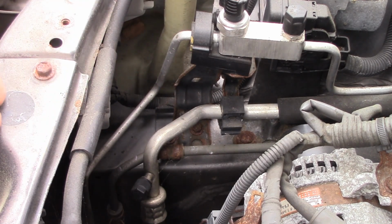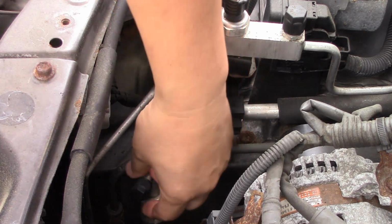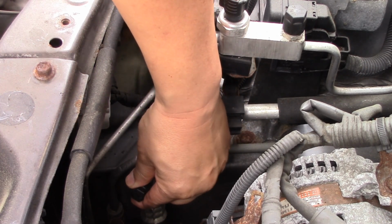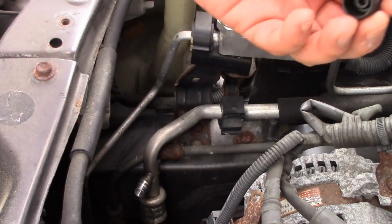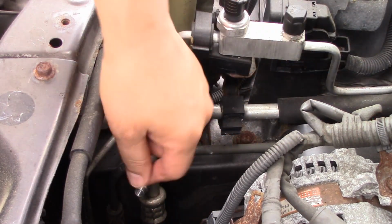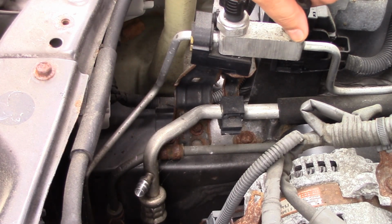Today we're going to look at this AC unit. I charged it, but it's low now. And I don't know if you can hear it, but when I undo this low side, there's a slight psh sound. So I know that there is probably some leakage from that. And when you do the high side, there's really nothing. So I think that side's okay.